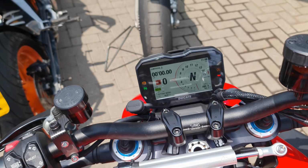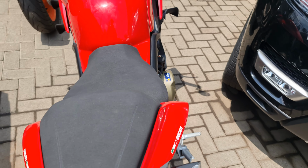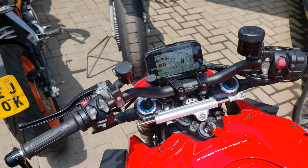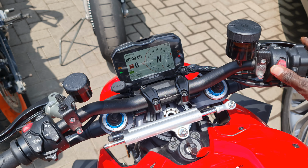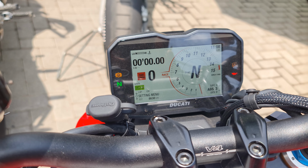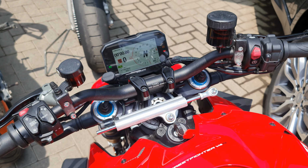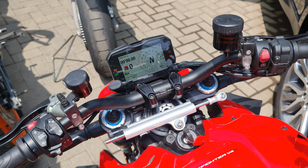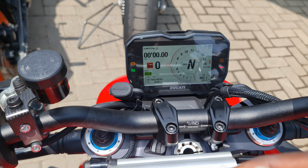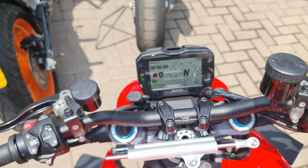One another feature I find interesting with this bike is, like right now, if I put it on, I don't know whether you can hear it, but I don't know whether you can notice, but when you are not moving, or you are moving, or the RPMs are, I think, below 4000 RPM, it is only running on two cylinders. Remember, this is a V4, it has four cylinders, but it is only running on two cylinders to make the bike more efficient, because when you're in traffic, honestly, you are not using all the power, so you're only using two. It is a technology I've seen on most cars nowadays, especially the big engined cars, but this is the first time as I'm seeing it on a bike. So when you are below 4000 RPM, it is running on two cylinders.